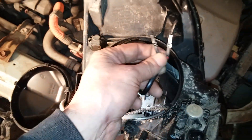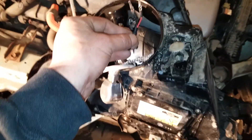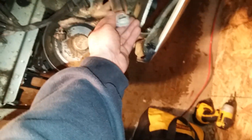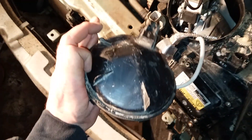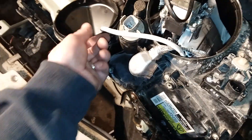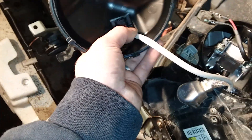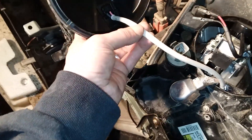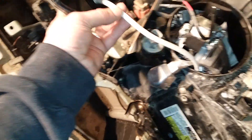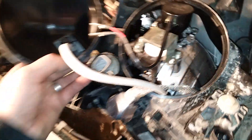Then you have the two wires that go into the light. These two wires will basically go into the harness connector that goes into the back of here. I'm going to tuck it all inside neatly — connect the black on here with the black, and the red on red, then just tape it up with some electrical tape. It'll all be tucked back inside this shroud anyway, so it should be fine.